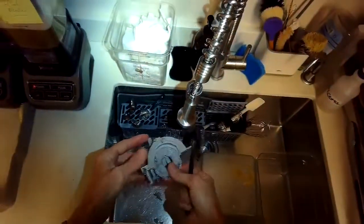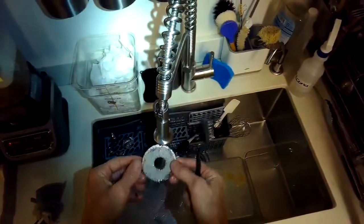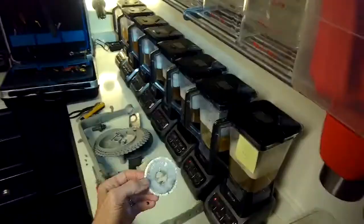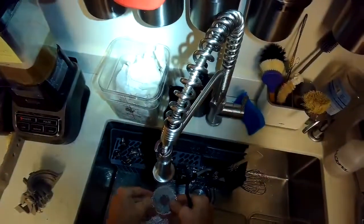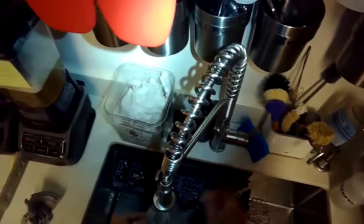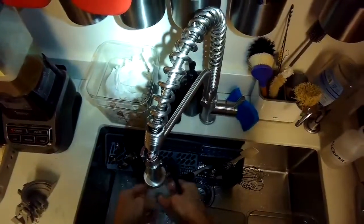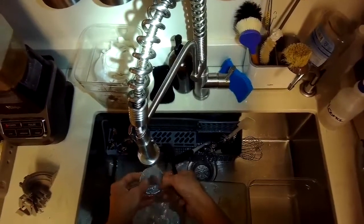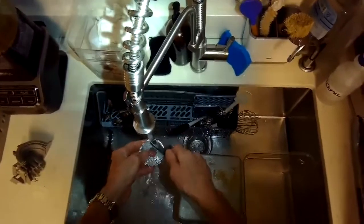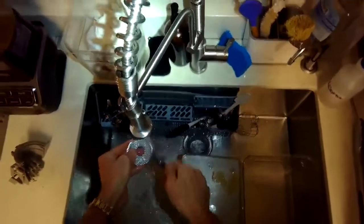Here's that part I was mentioning — it's like a little metal filter. It's super clogged and barely letting any water flow through. That blocks the circulation pump's ability to move the water powerfully, so it's not able to spray onto the dishes very strong — pretty anemic.